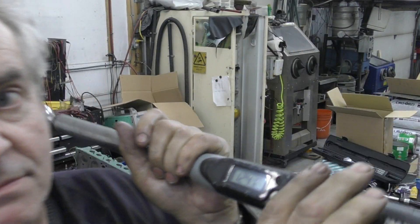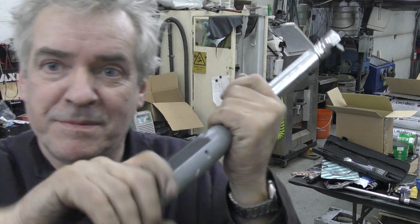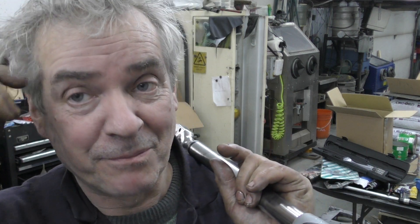I've just tightened down the head on this 300 TDI using the HS 2.8 method. What did I think of the Mastercraft torque wrench? I thought it was very good. One good feature is the counter — if you want to go up and down it counts extremely fast, which is good so you don't mess up. I like it because it beeps. One thing I noticed when you're torquing bolts down: you need to put a little bit of light oil on the thread and under the head, because if not it'll start jerking around and you'll lose your settings.